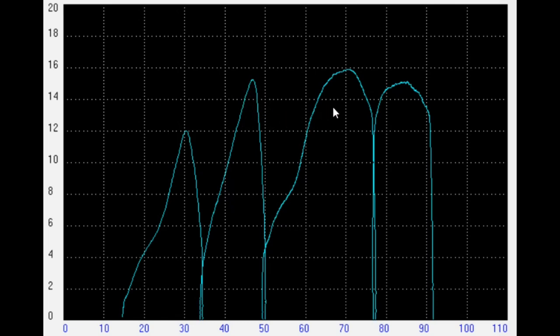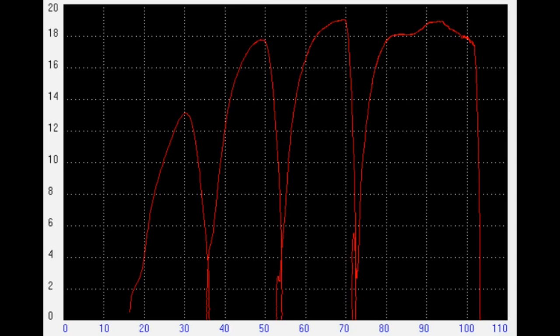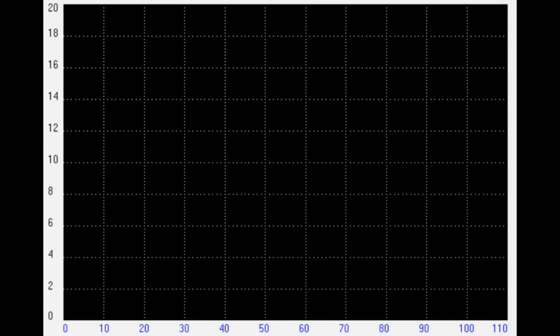But that price is offset because when you get out on the open road, if your motor was peaky and not performing between third and fourth, these two gears on an Indian GP200 are so close they almost form one gear. The difference is so slight that it helps you change from third to fourth when wind resistance out on the road is a factor, ensuring you don't drop out of the power if your motor is peaky. But if you've got an engine with a broad spread of power, then the LI-150 gearbox's more even spread is beneficial.